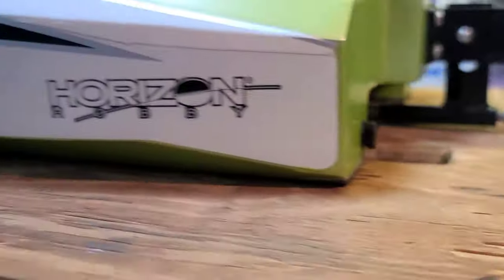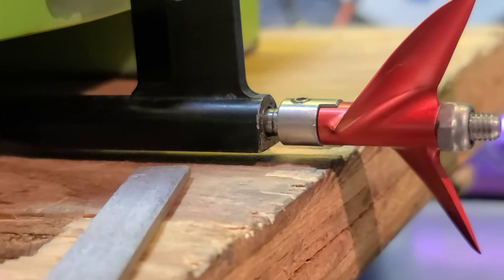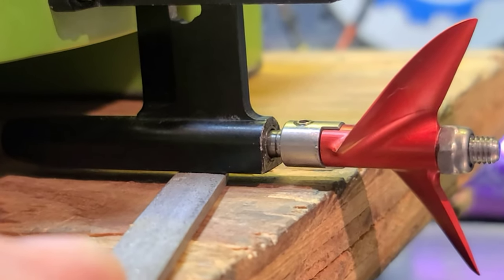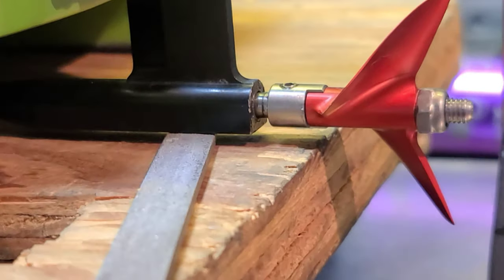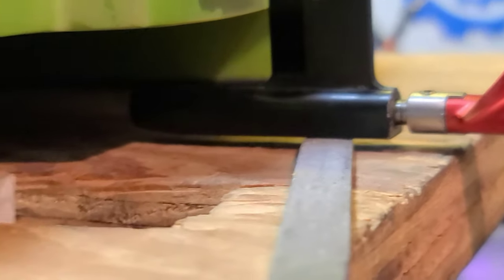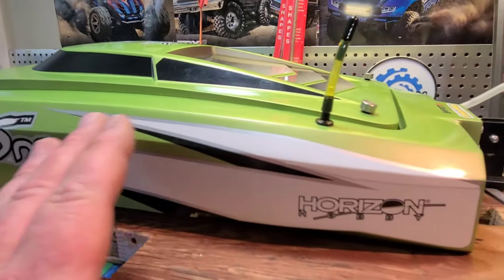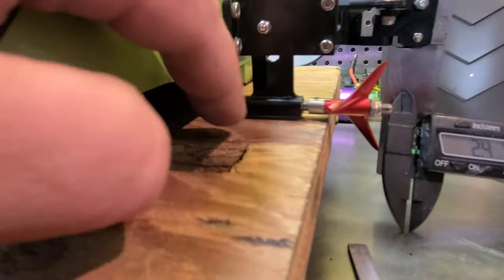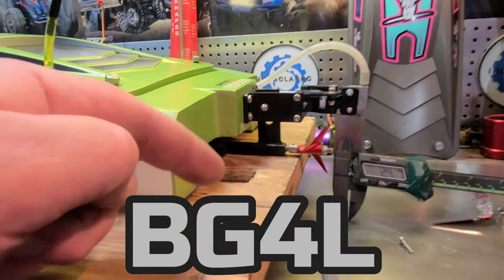This was my strut position — I've got it on my rigger setup board right here. Bonus for you guys who hung in here: I'm putting my file under my strut. She's sitting flat on the flat top — put my file under and she didn't want to flip in a turn as bad. That's how high I've got my strut off the bottom of the boat — that's how thick this file is: 2.4 millimeters off the flat surface. My boat is blueprinted, which does change things compared to a stock boat, but it's basically the same thing. Don't be afraid to go higher than the ride surface. Boat gang for life — we'll see you next time.